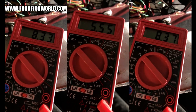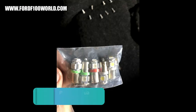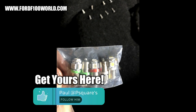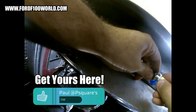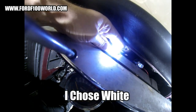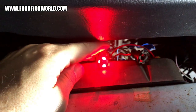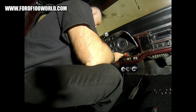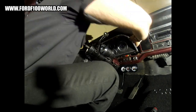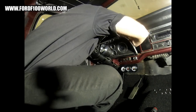Hopefully you'll get somewhere around 11 to 12 volts — I had an average between 8 and 11. These are the bulbs I'm using: LEDs. Green is for flashers, red is for high and low beams. I had a choice between blue and white, as you can see here. I also recommend testing them by grounding them out on the back panel. Don't forget to test your high and low beams as well as signals. Once everything's in, you don't have to completely reinstall your bezel, but turn on the lights and make sure everything is working.